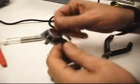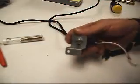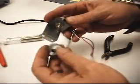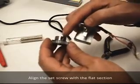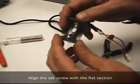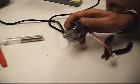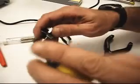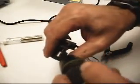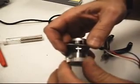Alright, now we got the potentiometer all soldered back and the heat shrink tubing done on it. We need to go ahead and put the gear drive wheel back on it. I got the flat spot here on the potentiometer, and that's going to correlate with the Allen set screw. So I'll put it right on there. Go ahead and tighten it back down. So we're all set up.